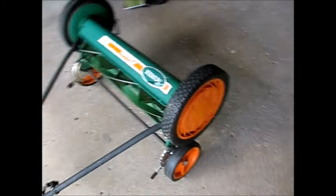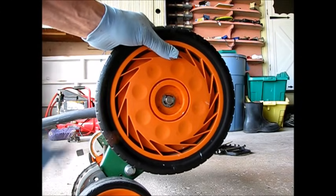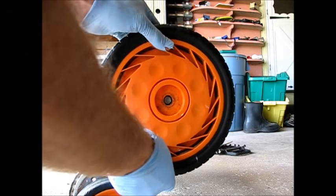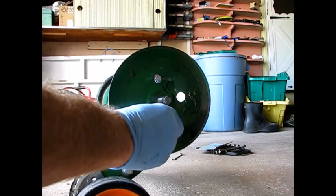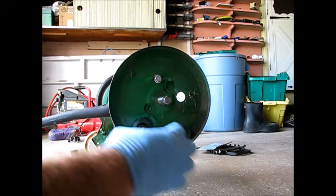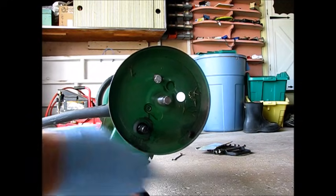Now we're going to prop it off like this on the back wheels. Working off the right side wheel, we're going to take the little hubcap off here. After that there's a C-clip that has to come off — with that off, the wheel will come off. Next up we have to take our little pinion gear off. Be careful because there's a little piece in here — a little kind of dog that can slide back and forth in here — we don't want it to fall out, we don't want to lose it.